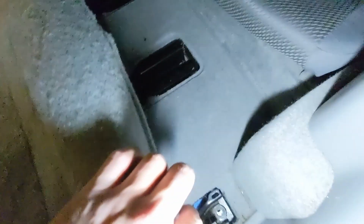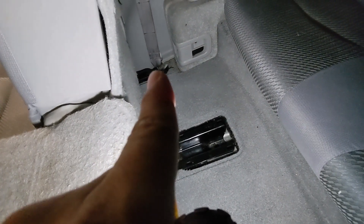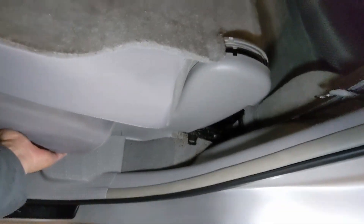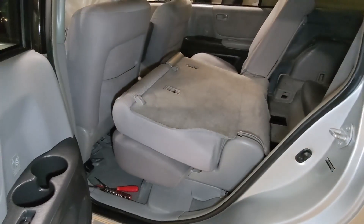You will have to pull the seat forward. Let me try to find a good angle for you. So there's one, another one, actually another two over here, another two over there, and the last one on the passenger side over there. Once all the 14 millimeter bolts are taken out, you can naturally wiggle the seat — it's no longer attached to the chassis. And the seat is pretty heavy, so better find a friend to help you carry it out of the car.